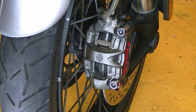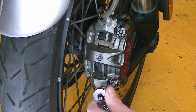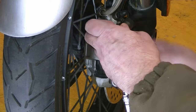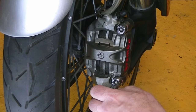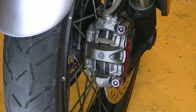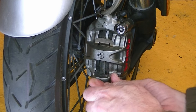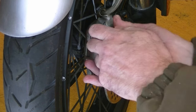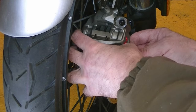It's always a bit of a battle setting the camera up so you can see what I'm doing clearly without it being in my way. There are just two mounting bolts for these radially mounted calipers — this is the right-hand one. I'm going to knock these off; they're quite tight, about 55 Newton metres when torqued down. The procedure for removing the front caliper is fairly straightforward: take out the two bolts and slide the caliper off the disc.